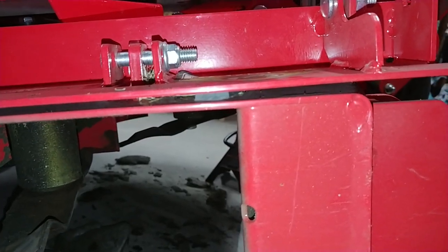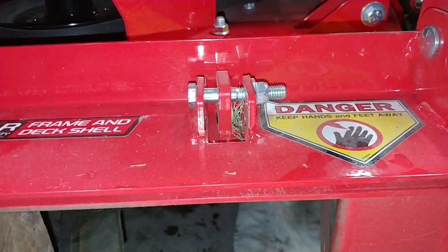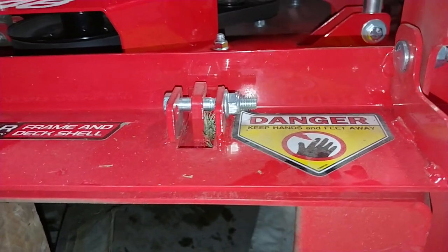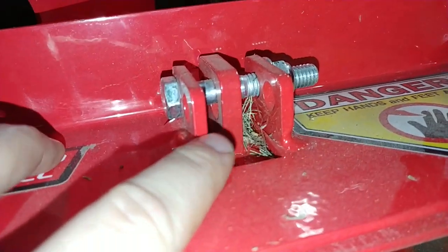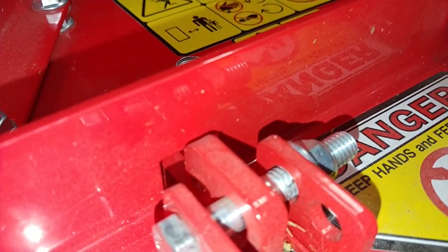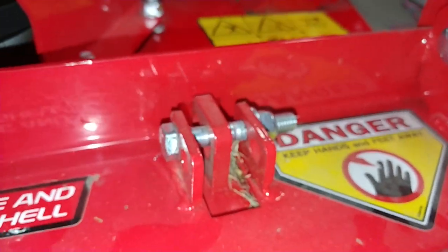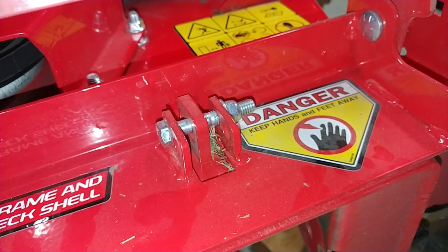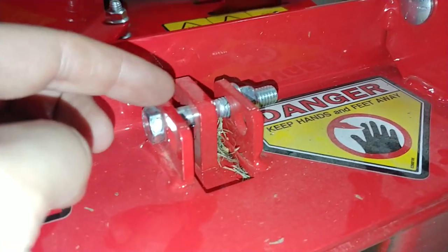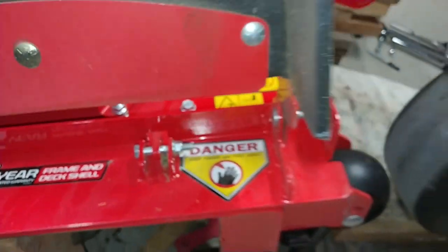I think it's coming from the discharge chute. It just slides in with this pole on one side and then one bolt in the center. Mine was kind of loose, and I think it's because the hole in mine is actually oblong while the inside hole is circular. When I was at the dealership getting oil filters today, the holes on the new ones are flip-flopped — the oblong hole is in the back and the circular hole is where the bolt goes. So I think mine was actually messed up from the factory.